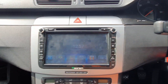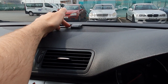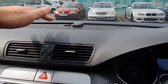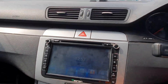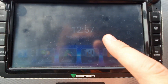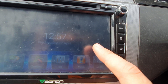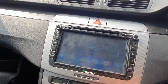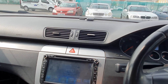Other than the unit being a bit slow, everything else is normal. The microphone is still wedged in up there, and up here is the GPS antenna — it's magnetic so it doesn't roll around, there's some metal underneath. You've got to have it exposed up to the sky for a better signal, so you'll get the time working correctly and the speedo will be more accurate than the car's own speedo, because it's relying on GPS.